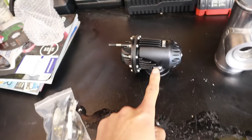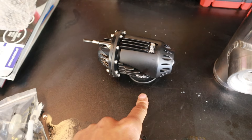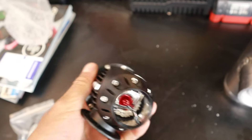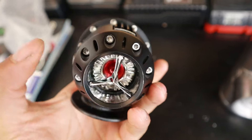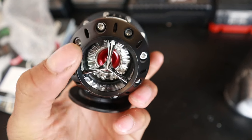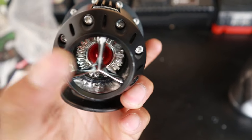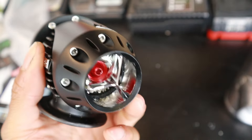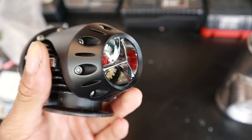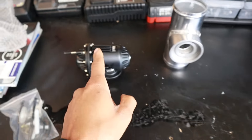I'm kind of excited — I used to run an HKS blow-off valve way back in the day, and then one day after four years of running it, it decided to fall off the car. But if you guys didn't know, you can remove all these inlets to remove the face and take out that little chrome piece in the middle. That chrome piece changes the way the air comes out and the sound. With it in, you get more of a high-pitched Fast and the Furious blow-off. If you remove it, it makes a really deep-toned, whiplash sound.